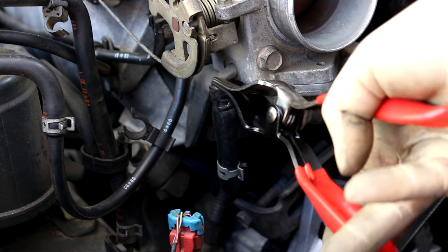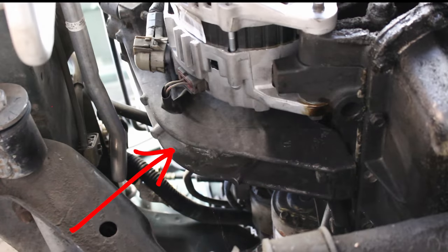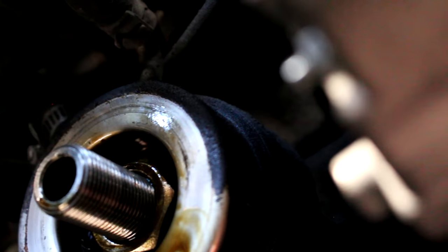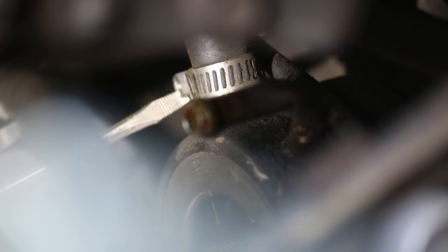As we go towards the back of the engine, these hoses get more and more tricky. You'll see I'm going to remove this one here with one of my favorite tools — the hose persuader. I'll link that down below; it'll get pretty much any hose off with ease. Now coming back here to the oil cooler — oil warmer, whatever you'd like to call it — it's pretty hard to get to from the top or the bottom, but if you remove the intake manifold brace, held in with two 14mm bolts on top and one more 14mm behind the alternator on the bottom, once that comes out, look at all that space you generated. You can remove your oil filter, and behind it up above there are two hose connections. These hoses are just as important as the rest of them even though they're way harder to get to. You might find a mix of spring clamps and hose clamps depending on whether the car's been worked on before.